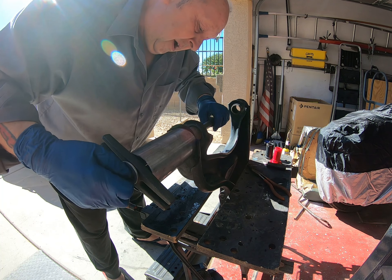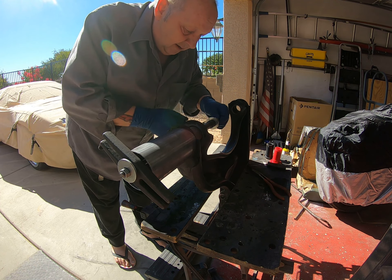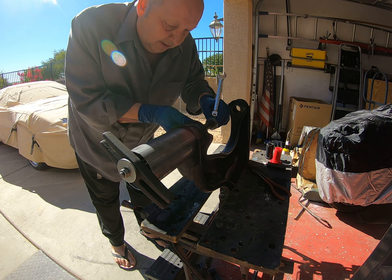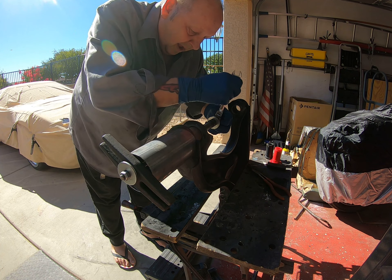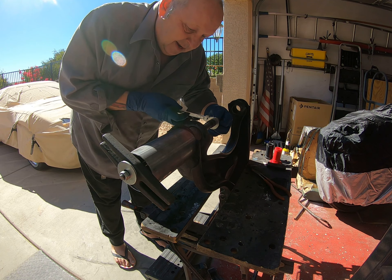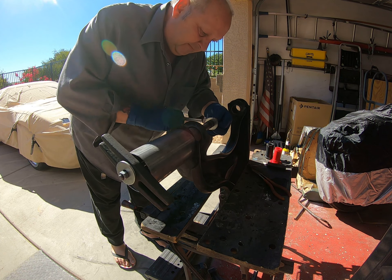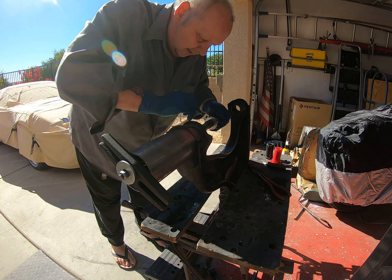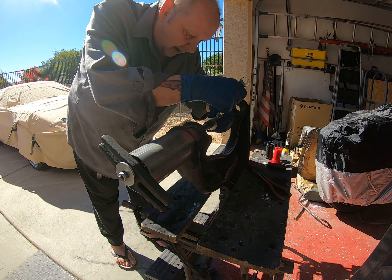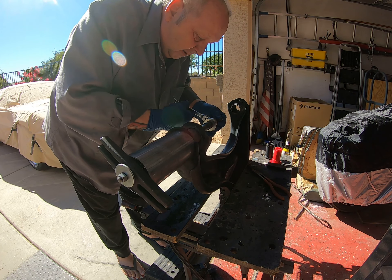That is now pinched up. Grabbing one trusty wrench of the correct size and putting it on the right way around. What this is doing is pushing these in here and it's going to push out the sleeve. If I'm lucky it may even push out some of the rubber - when I did the other side it pushed out the rubber as well. Because of the tension it's not turning so I'm just holding it, and that is pushing it out beautifully. The reason I put that sleeve on there is so that I'm not right up close to the washer.